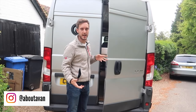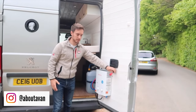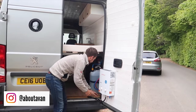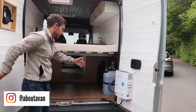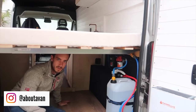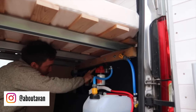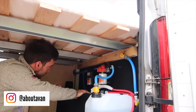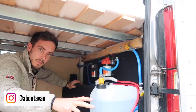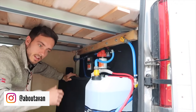I'm going to show you inside the van — I'm all finished now and I'm going to show you what I've done underneath the bed. We've got the Camp Lux installed on the back door. This is the little barbecue hose which is held by a nice clip so it doesn't fall off when you're driving along. In here we've got all the plumbing which is linked to the water canister. We've got the ShurFlo pump on the side which then goes straight into a pressure vessel set to 42 psi, and that then goes off into a tee piece — one which goes to the tap inside the kitchen and one which runs along for the rear shower. So all I do is turn the pump on and the whole system's got pressure — shower and tap — and then when you're done with showering or washing dishes you turn the pump off.